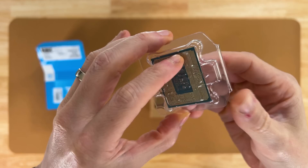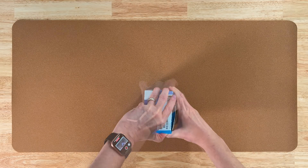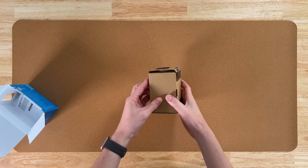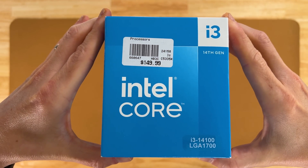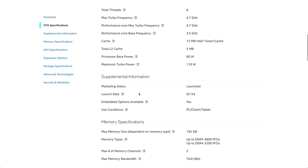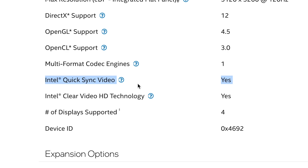First is our CPU selection. My choice isn't the one with the most cores, the most features, and the highest clock speed — it's quite the opposite. I look for a modern processor that has the least amount of cores, lower clock speeds, and integrated power saving features. I chose an Intel Core i3 14th Gen processor for all of these reasons and because it has an integrated GPU. QuickSync is a technology from Intel that allows you to transcode video for Plex efficiently and without the need for a dedicated graphics card. This not only saves us money but also saves energy.